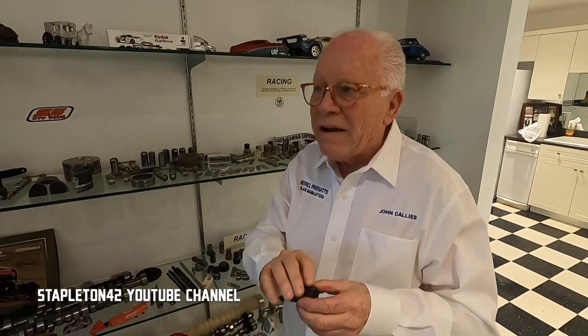When I did the first gears, my test was on the Spintron with 50 weight oil. You'd start it up and instantly rub it up to 6,000. With high pump pressure, a standard gear would go 35 seconds and then it was gone — 35 seconds. The first one I tested with Roush went 200 hours. Wow. Big difference. Not a small difference. Big difference.